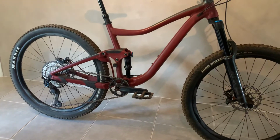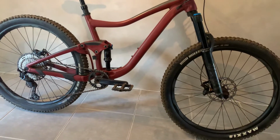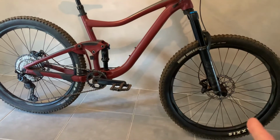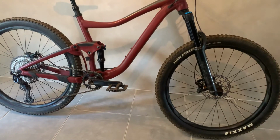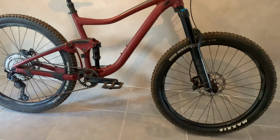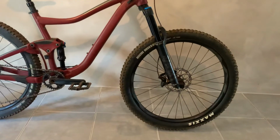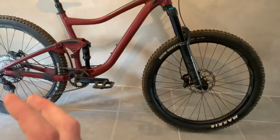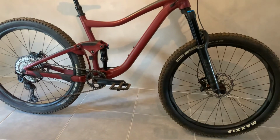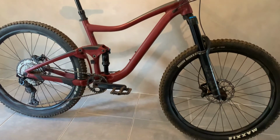Again, for where I ride, it's a lot of pea gravel and a lot of clay. It did slide quite a bit. These High Rollers are fantastic. You set them to the good pressure, they are really, really comfortable and make the bike really responsive. In the clay where I ride in Dulwich Hill, I usually run about 30 PSI in the front, 32 in the rear. It's really, really comfortable. If I'm going out to pea gravel, I'll usually drop it maybe 5 PSI each side.